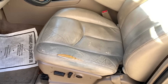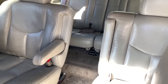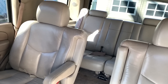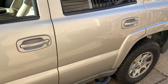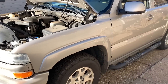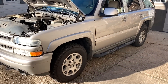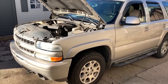For the interior: first thing I'm going to do is cleaning — I'm just going to take some carpet cleaner, spray it, use a brush, scrub it real good, and then wet-vac it out until I get it as clean as possible. Back seats I'm going to scrub down with some leather cleaner and condition them. The third row I'm probably going to take out because I really have no use for it. As far as the body — I really want to give this thing a really good wash but it's freezing out and any water or ice spray is just going to freeze up on the truck. So I'm most likely just going to take it to one of those drive-in express washes. I didn't do paint correction on it yet so it's not really a big deal — if it warms up I'll take it there, have them wash it, and maybe clay bar and buff it myself. If not it's just going to have to wait until spring.